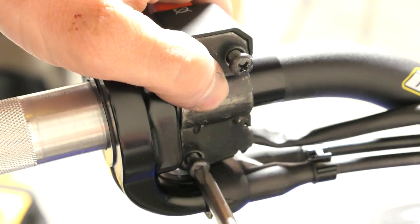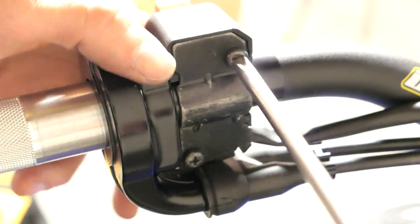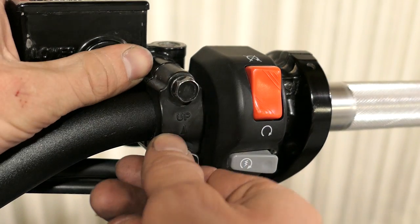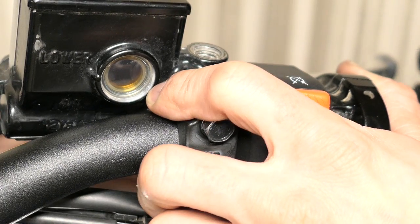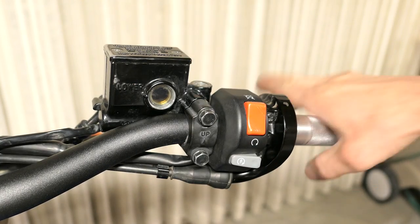Before installing the throttle tube for the final time I'll squeeze in some cable lube and apply a little bit of white lithium grease to the throttle tube contact points. Install one cable at a time and wrap around so the cables run on top of the raised end of the throttle tube. Hold the cables together as you slide the caps on — find its pre-destined spot so the alignment pin slides in, then install the screws. Remember they are different sizes; the longer one needs to go closest to the cables. Install the switch cluster — the plate goes on only one way but the screws are the same length on this one. Throw on the brake lever assembly and snug it up making sure the cap is pointed up.